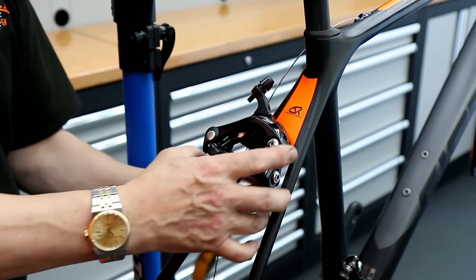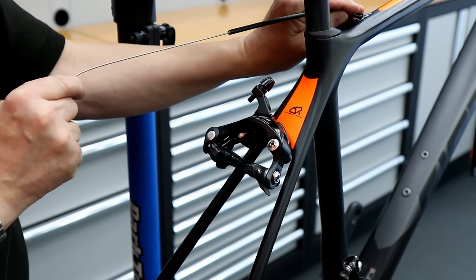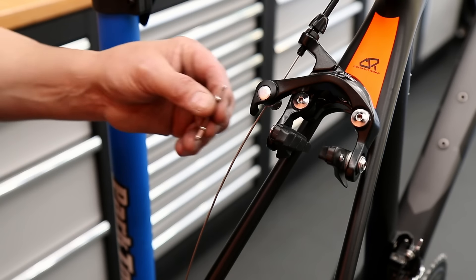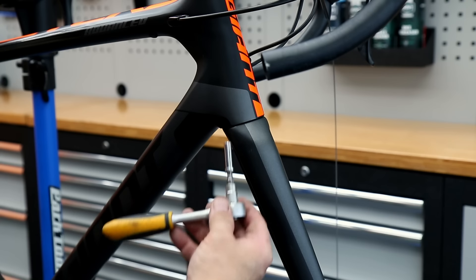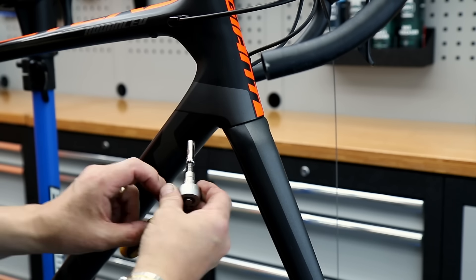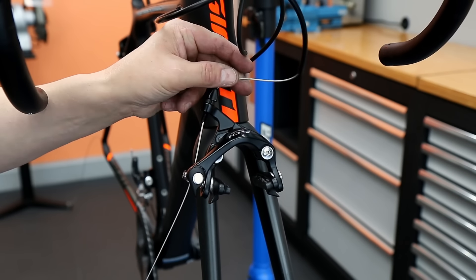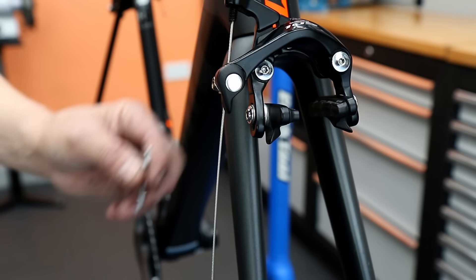Next up I'm putting in the rear brake — this was loose when it came in, moving over to one side and pulling the wheel over. Again, all new cables make a big difference to how that will feel. I use the same cable guide as before for a nice uniform finish to all cables — I personally think that's a nice detail. Then onto the front brake — a little bit of copper grease on the mount itself to stop that bonding into the frame, making it a lot easier to service in the future. On goes the front brake cable and we lock that off with our cable guide.